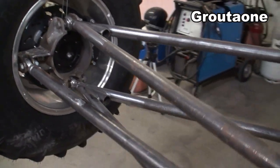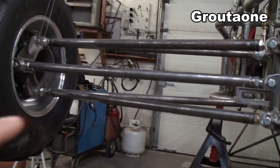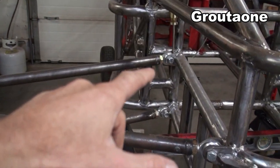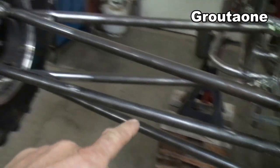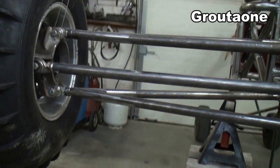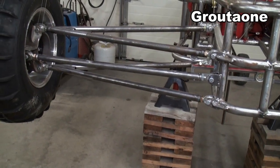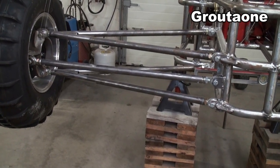The pivot points have to be all in the same spot here and there. The other thing that's really critical is to keep the A-arms the same distance apart. If I measure on the inside here, A-arm to A-arm, it's the same at the back here, and if I go to the other side and measure there, all three points are exactly the same. That stabilizer link is critical too — it has to be parallel with the A-arms, and then it's pretty happy. I don't have different components fighting with each other because they'd have a different radius as they go through the sweep of the suspension.